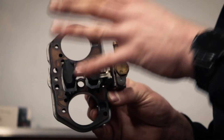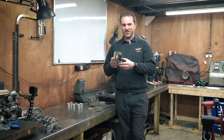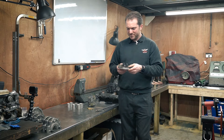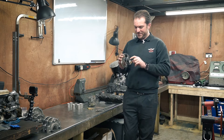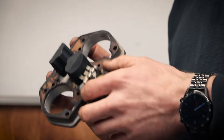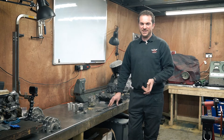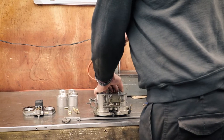If you get it wrong - if it's too low when it's resting, the fuel bowl won't fill up properly and you might have a situation when you're accelerating hard where it suddenly runs out of puff because it's gone lean with no fuel. The other thing is if you have it too high, it'll overfill and you'll have fuel spilling out all over the place, which is quite dangerous. You can also get different sizes of needle jet and needle valves - for a high performance engine you might want a bigger fuel orifice. On my car I've raised fuel pressure from 3 PSI to 5 PSI and also have a bigger jet needle.